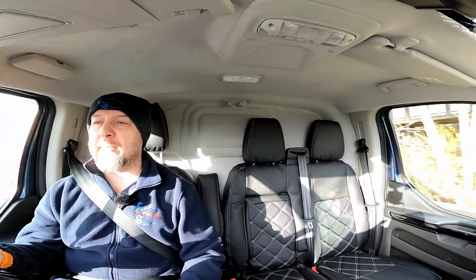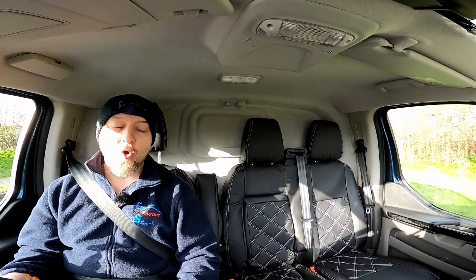It's got AdBlue, and that does mean you have to keep topping it up. I get a warning when there's 1,500 miles worth left. If you're on the road all day every day it can go down quite quickly, but for me it doesn't. AdBlue prices have doubled — first time I bought a 10-litre it was £16, last time it was £33. What you don't want to do is run out of AdBlue, because if you do there are severe consequences — it can really gunk up your engine and foul everything up.